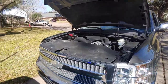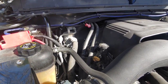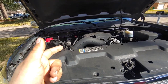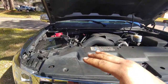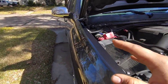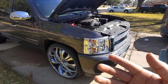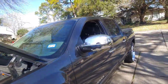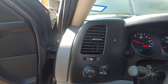I'm going to pull off these gaskets I have installed and you can see just how crappy they are. If you're not sure whether you have a valve train tick or an exhaust tick — this is 100% a header exhaust leak from one of the primaries. It has the speed of a valve train tick: a slow tick with a rhythm. One thing to tell the difference: an exhaust tick will get louder under load, so if you put it in drive and put the motor under load, it will get louder.